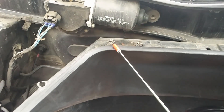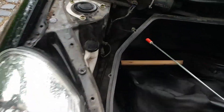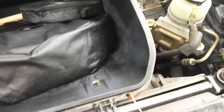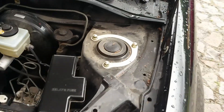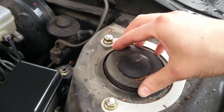The first thing you need to do is remove these four bolts to remove the frunk cover, and then remove all these plastic clips around it, which hold this big plastic piece on. I already removed that off camera, but it's just annoying removing all those plastic clips.